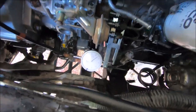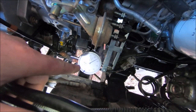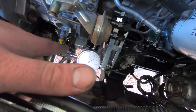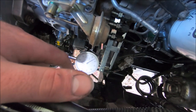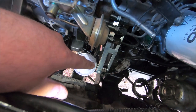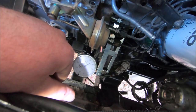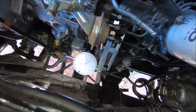So what I'm going to do is rotate the engine in reverse from top dead center until the dial indicator stops rotating. When that stops rotating, I'll zero the dial indicator and then rotate the engine back around to top dead center and check the adjustment. Now if I'm right, it's going to be about 0.05 I think, whereas it's meant to be 1. So we're going to have to adjust it so the dial indicator does one full revolution back around to that point, and then we'll be right to go.